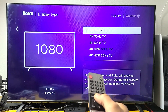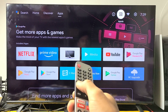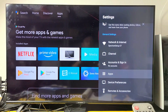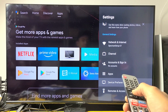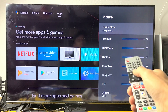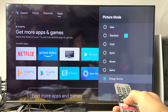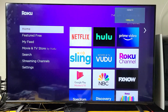I have a Skyworth Android TV here. I'll go directly into my settings — go to the homepage on my TV and then go to settings. On my TV it's under device preferences, but depending on your brand and model it's probably going to be somewhere else. Mine is under device preferences, then I go down to picture. I have my picture mode on energy saving. Make sure you're on energy saving or low power. Once you change that, fire back up your Roku Ultra and see if the black flashing screen is gone.